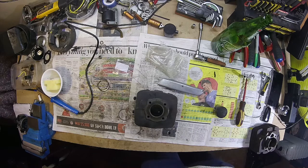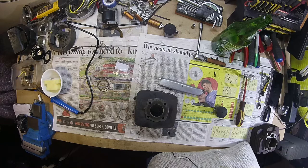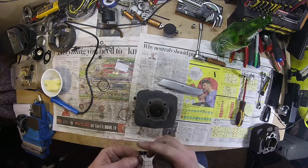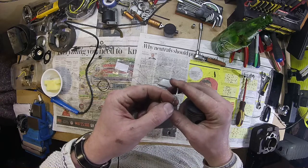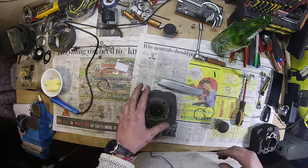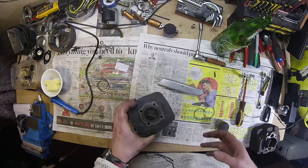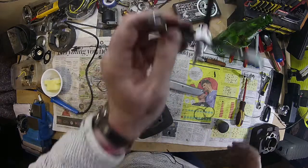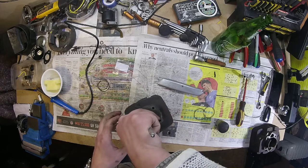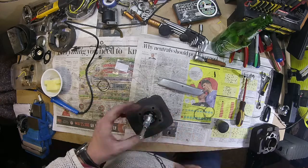I don't know — is that good? I suppose it can't be too tight can it, because these have got C-rings on them with the locating pin. The bottom is always going to be a bit bigger, so that should close up nearly perfectly. So now — do I hone this first? I don't think it's going to hurt to run a hone down it. Let's be honest, and I've got plenty of spares. Yeah, I think we're honing that.